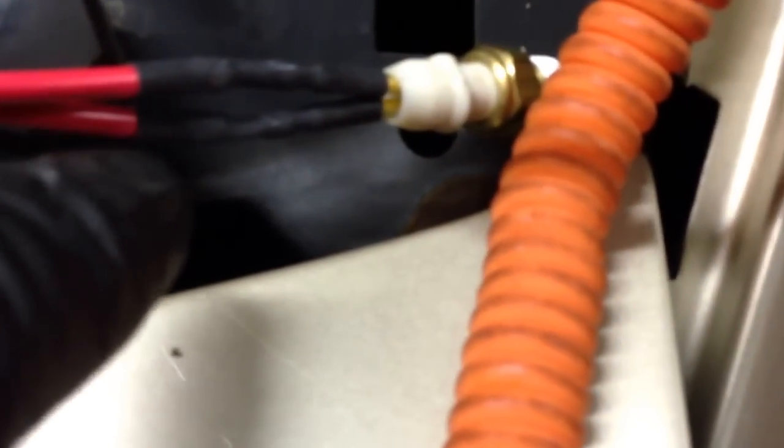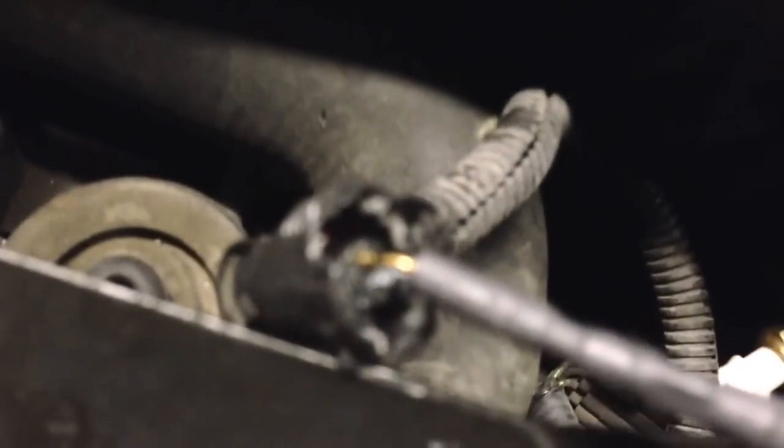I've got an air temperature sensor there. What I've had to do is run this little cord basically going all the way to the battery, so I know I'm getting a known good ground. That ground now goes into the sensor. The other secondary wire, the one on the bottom, is coming up here and pinning into the plug.